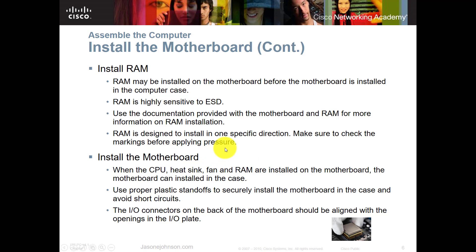Next, install your motherboard. The motherboard only goes in one direction in your case, and there are specific screws for specific spots — consult the manufacturer's information on where those screws go. Do not over-tighten, and don't tighten them one at a time. Put all screws in and get them about 90 to 95 percent tightened, then check that everything has proper clearance and is seated properly before going back and tightening them all the way. Make sure your IO connectors at the back are lined up properly.